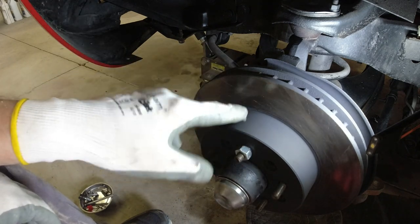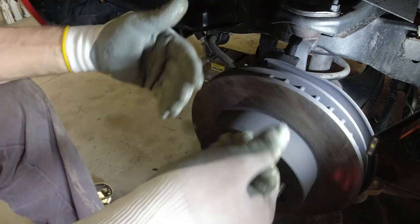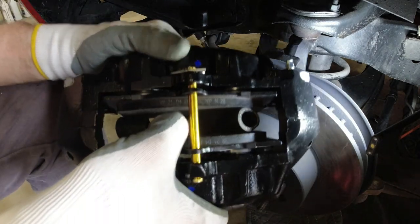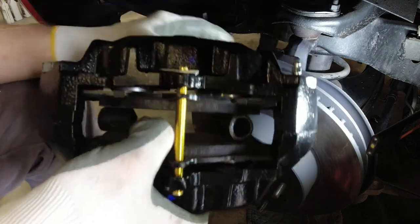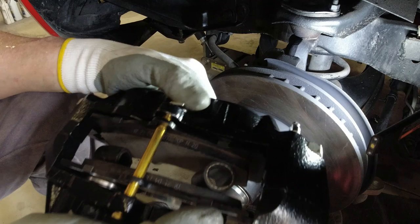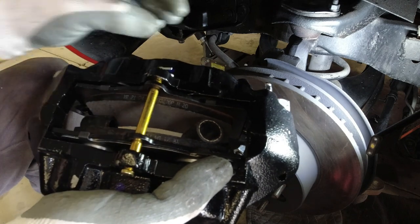When I put my rotor on, I like to put one lug nut on just by hand — not tightened down with a wrench — just to kind of hold the rotor from flopping around while you're trying to put the caliper on. These are four-piston calipers, two on each side, so it's pushing evenly on each side of the disc, and it's mounted rigid. A lot of newer cars only have pistons on one side, so the caliper has to float to stay centered on the disc, where this works from both sides and equalizes pressure.